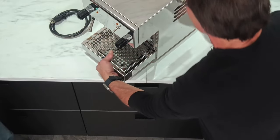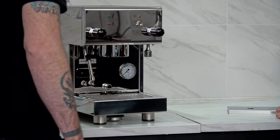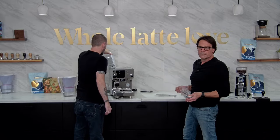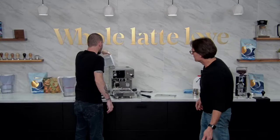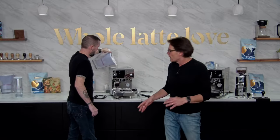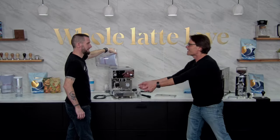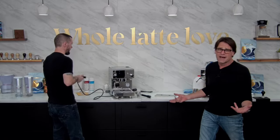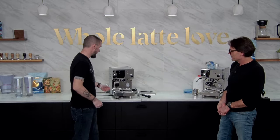Well, let's get some water in this. We'll talk in a minute about water quality. First things first, make sure it's all the way filled up — don't want to interrupt your filling cycle. I always like to keep the machine unplugged when I first fill it up, just in case. We do just want to get this one heating up. We do have another one here that's already heated up — it's like those cooking shows where you take it out of the oven already done — because we just want to get you making a coffee and a latte right away. I'm ready to plug her in. We want to leave this off because we want to watch the water go down, make sure the water is actually going down in there.